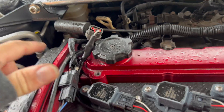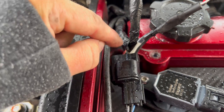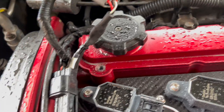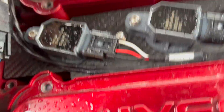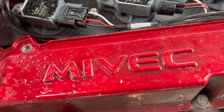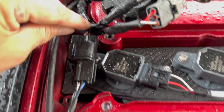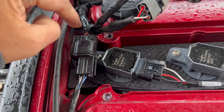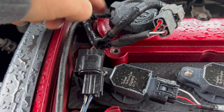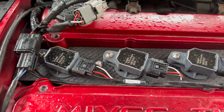To get the plug cover back on, I'm going to have to separate this bit of wiring out of that bit of harness and rewrap it so there's enough length for that plug to go behind there. I'll tape it up into the loom. I don't think I can tuck it underneath because of the wire lengths. To make this fit, I'll just trim that little bit of wiring, unwrap it, and then rewrap them as two separates. That side looks okay — might tuck it down the way instead of along the pipe, but I think it's fine.